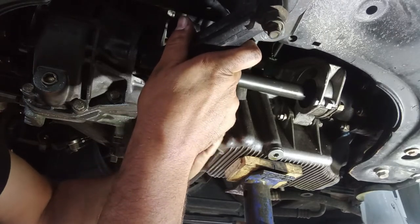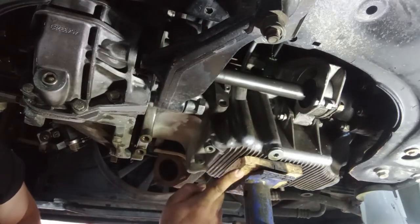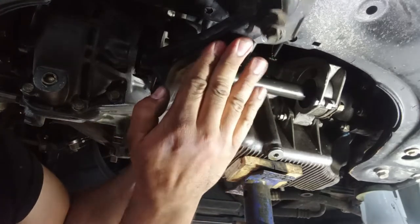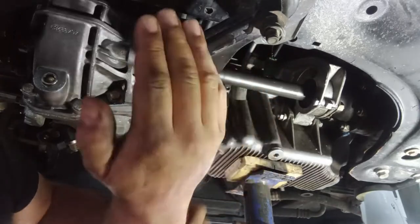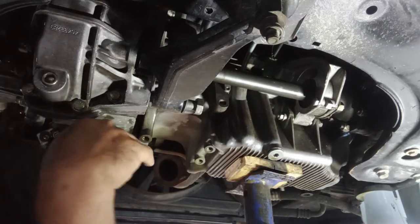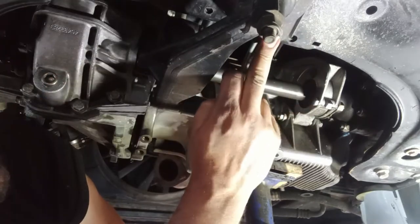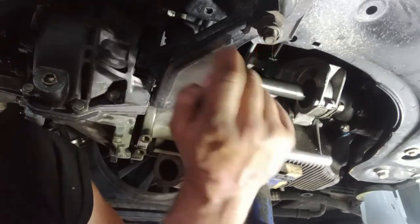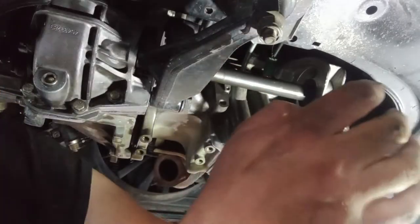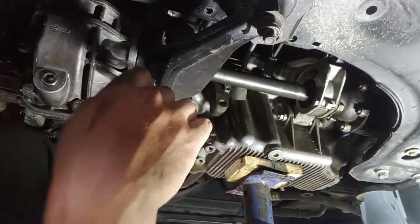Normally it will work, because remember that you took out this assembly already with this in mind. So this contraption over here was already steady at the disassembly, okay, to be able to take off easily. And if it went out easily, it also will go in easily. Now my 19 millimeter bolt, where are you? So next we have to put here the two 13 millimeter head ones over here and there, and with that we can take out here this jack stand and work a little bit easier here on the bottom of the engine of the car.